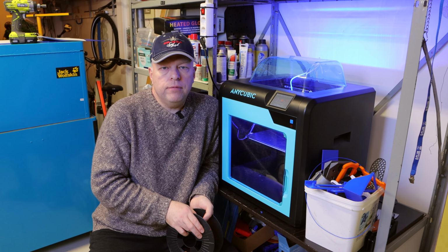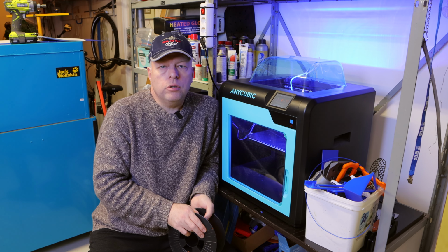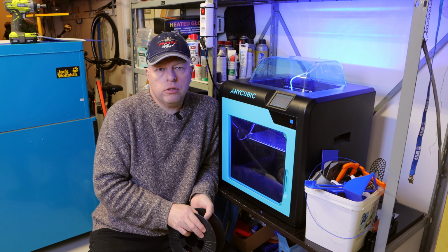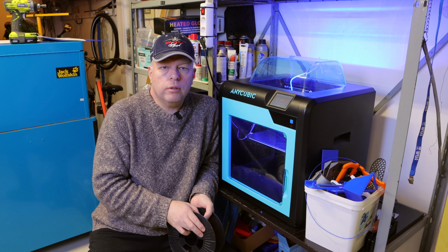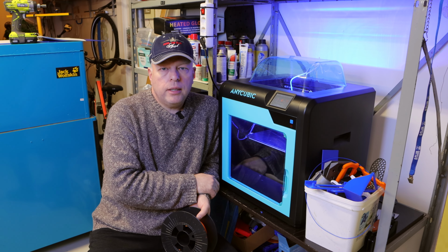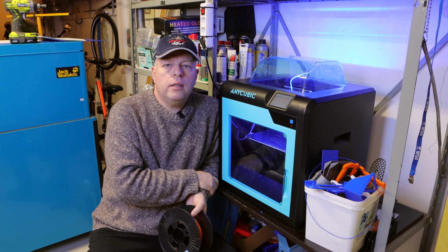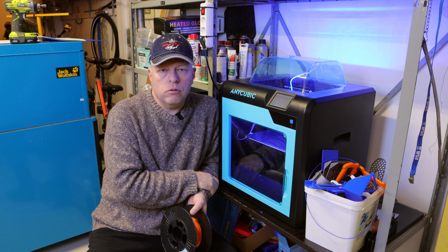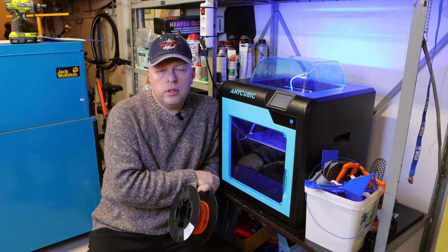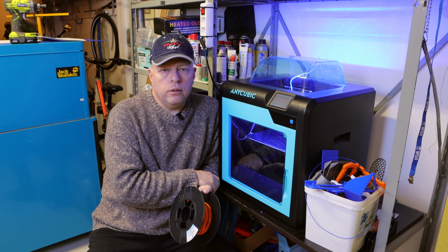3D printing, or additive manufacturing, is the construction of a three-dimensional object from a digital 3D model. I create the model with a computer application, which I will show in a minute. Then the file from the model needs to get to the 3D printer. I use the memory card. This printer will take in the filament, which is this kind of plastic strand. The printer head is very hot and it melts the filament continuously. Then the printer head moves over the parts bed and melts the filament layer by layer together. The printer head moves according to the design file, which is sliced into layers.